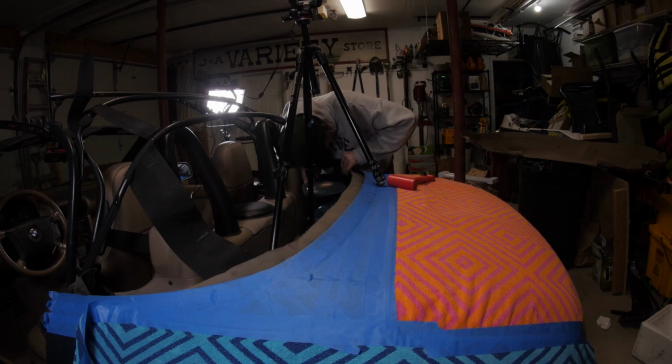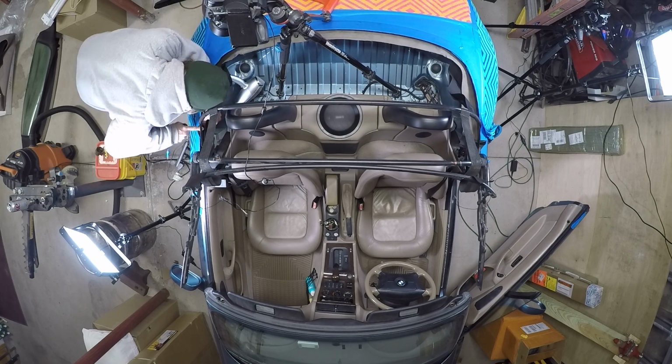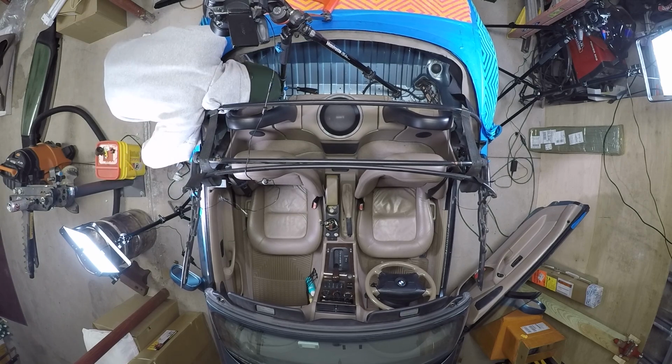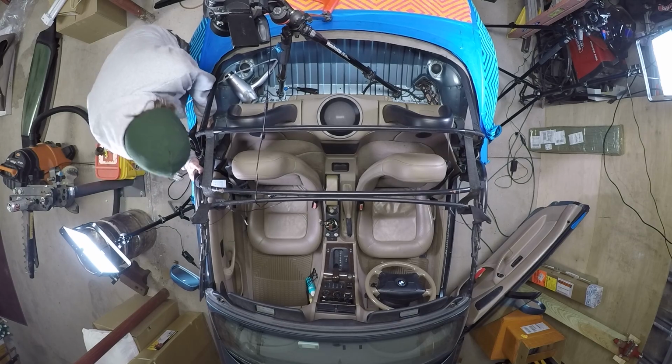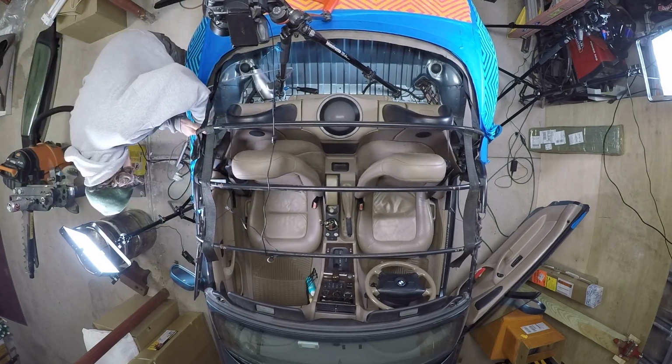If you grab the bow right now and try to remove it, it won't come out. That butyl tape is some crazy stuff. After hours of trying things, I finally decided to try heat. I'm using a hair dryer here. You could use a heat gun, but be very careful. Those things get really hot and could potentially melt or warp the plastic ceiling frame behind the bow.